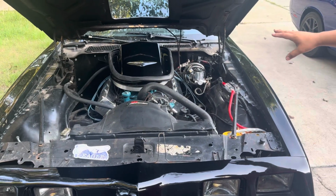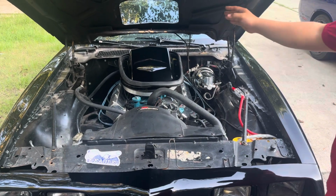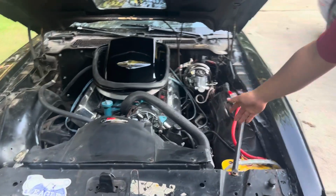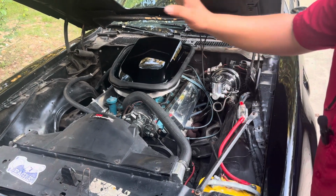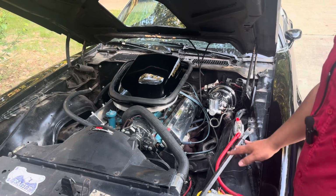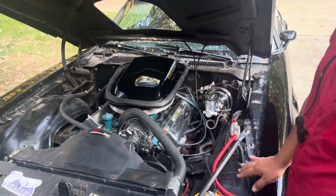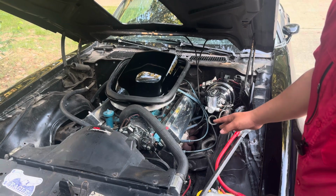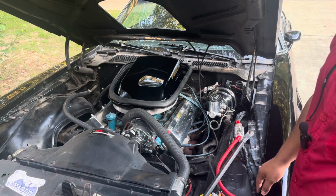The whole 455 top end package on these cars, if you do the conversion, you're going to run into the shaker fitment issue, like I said, and you have to modify that. Then we ran into the issue of the valve covers, because when we put this motor together, it's still the flat tappet cam. I'm sorry, the camshaft package, I forgot to mention, was a W31. It's a Mondello MW31 cam. If you Google that, you can look up the specs, or I can put it in the description. It's still flat tappet, but we put roller rockers on it up top for better longevity.